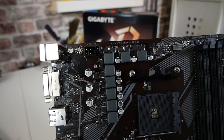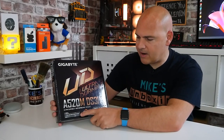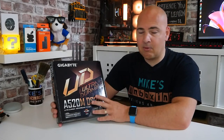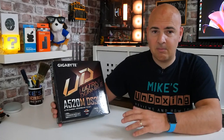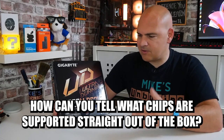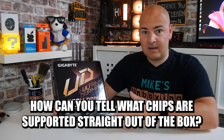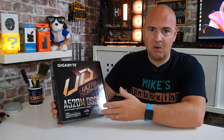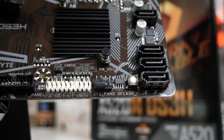If you're looking to do some overclocking, this probably isn't the board for you. It's got the third-gen Ryzen Ready label on there. Depending which version of the board you get, yours may have a 5000 series ready label — if it does, 5000 series chips will work out of the box. If it's got the 3000 series sticker, it will need a BIOS update. Just look at the label to determine compatibility. This board does have USB flashback, so you can update your BIOS very easily without needing an older chip.